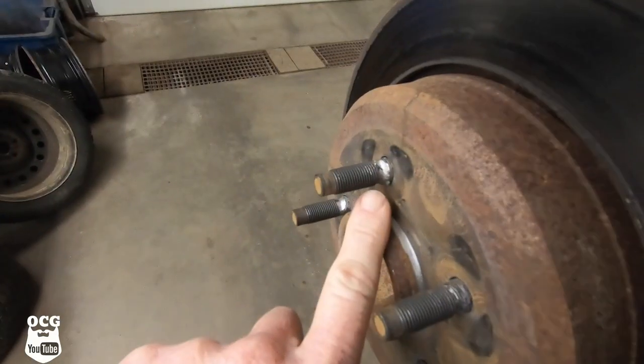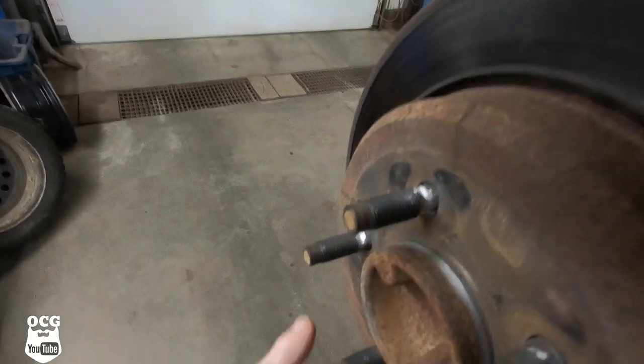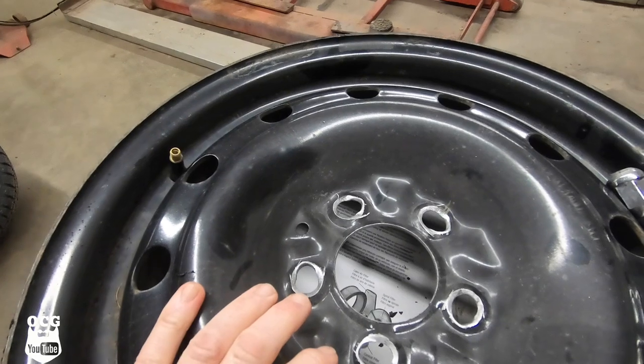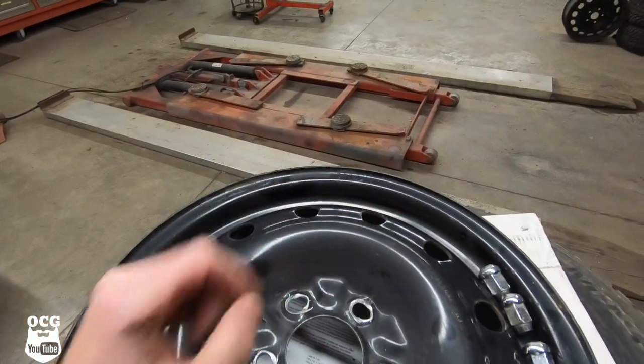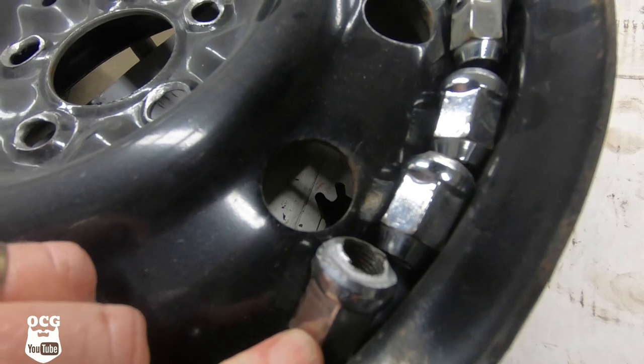We put the lift kit on last weekend and I've been driving it all week. You can see the studs are all grooved up — all five have marks on them to the point where they could have sheared off and I could have lost the wheel. Here's a better look at the wheel: the lug nut holes have been ovalled out because it was wobbling around on those lug nuts, and even the lug nuts themselves are all chewed to pieces.